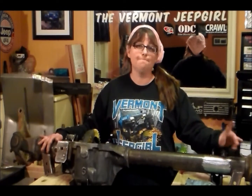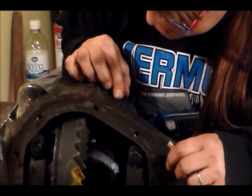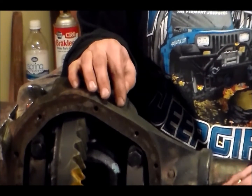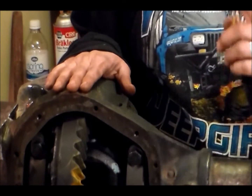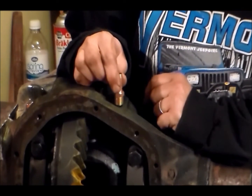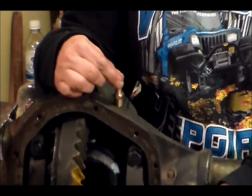I bought a really cool brush that I believe I can fit right down inside there. I'm also going to throw on a coat of paint, so what you see here will be all freshly painted. One other thing I'm going to do to this housing besides painting it — where the breather vent was, it's fallen out when we were moving it around; they just sit in there. On old Blue, the first axle I ever set up, the YJs have this little plastic fitting that had failed on me. Not knowing this, I was in a lot of water and ended up getting a lot of stuff inside my differential and screwing up a lot of stuff in there. So ever since then, what we do is take the little plastic fittings out and we drill and tap it, and we add this new fitting which goes down inside here. Then this is where we run our breather vent up. I'll also be doing this same thing on the T18 that I have sitting on the floor right in front of you — it's a nice little upgrade.